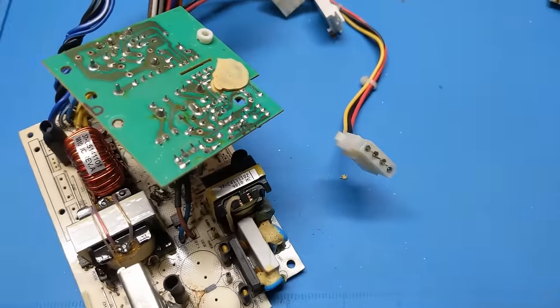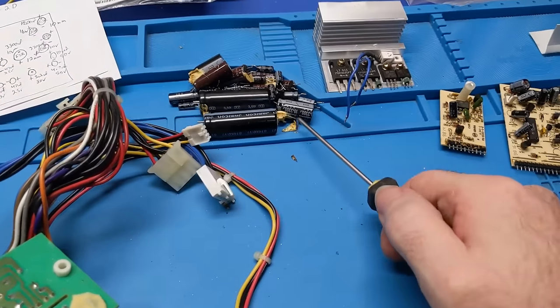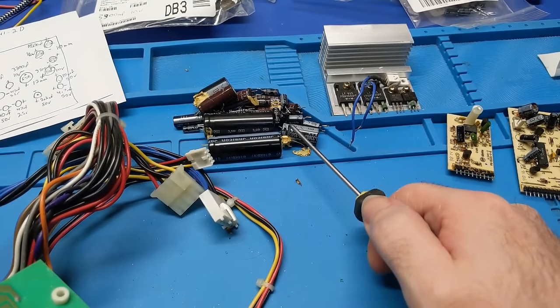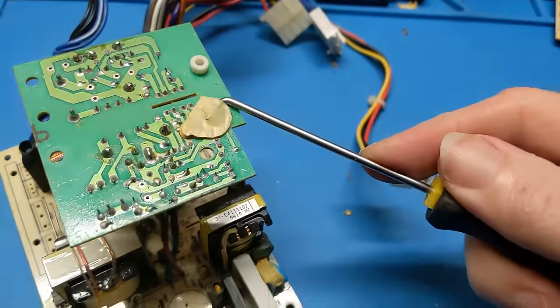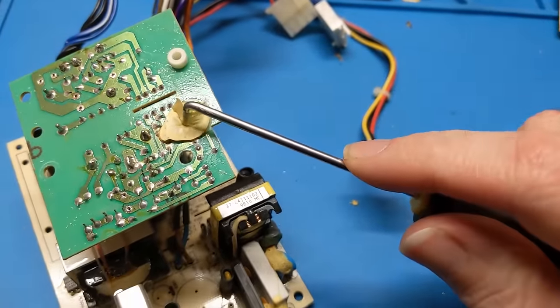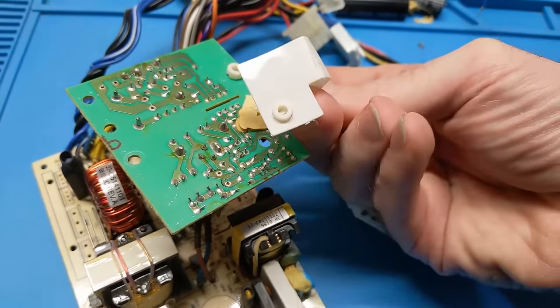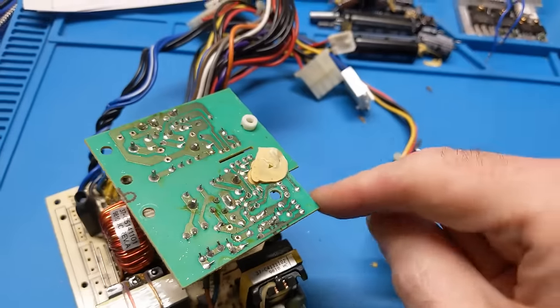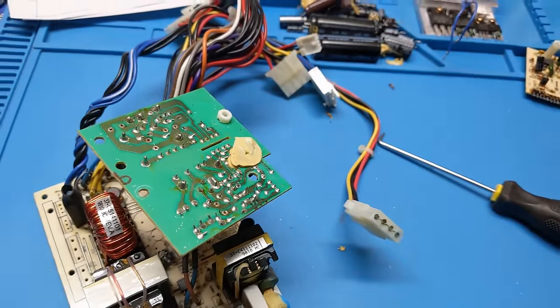And the other thing that's driving me nuts is while I got this apart, I'm trying to pull all this hygroscopic glue that goes conductive and turns brown after a while. And it's ruthless. This stuff is just hiding everywhere. So trying to get all this off, like this was hiding underneath that, because I had to get that off in order to get to one of these caps. Yeah, it's an issue.